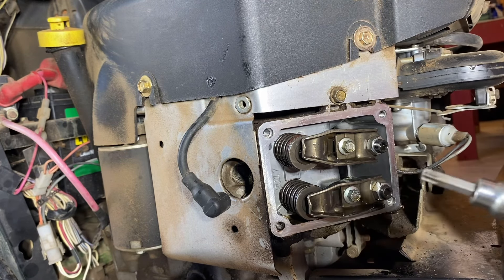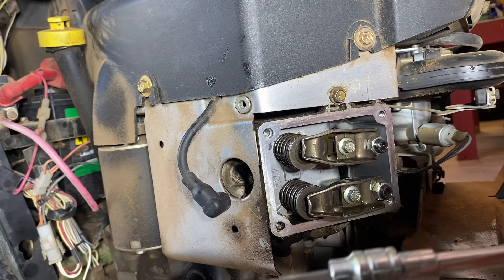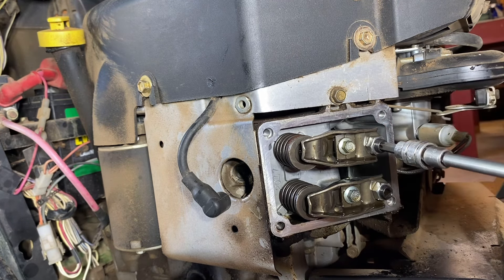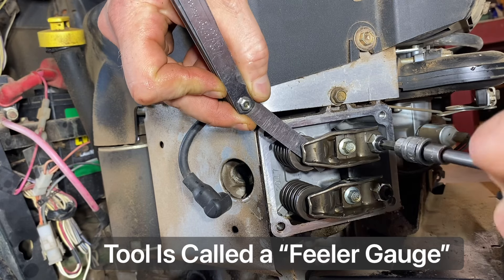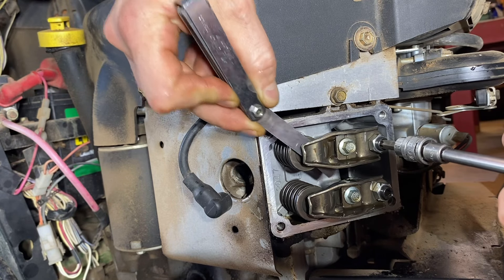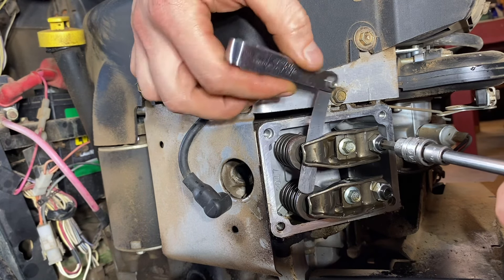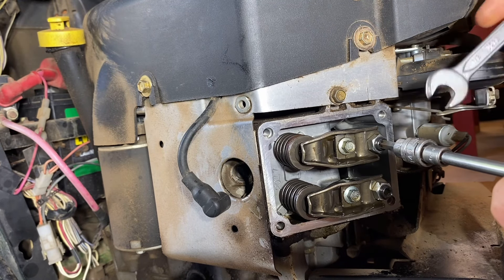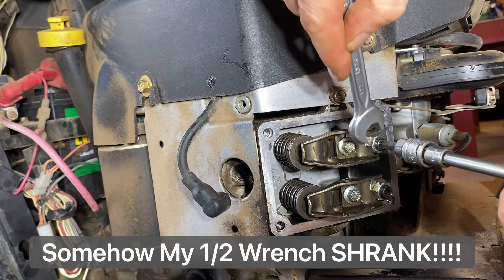Now to save you a ton of time and cursing, I like to put it on a regular screwdriver end with the head on the end. That way it gives you a lot more control. So what you're doing here is tightening it down until it feels tight but not too tight. This one's way loose. Back it off just a bit — there we go. You just got to play around with it a bit. That feels pretty good where it slides in; you feel that restriction there. Then you want to hold that T40 tight as you lock down the lock wrench. Don't let her move or else this whole process gets jacked up.